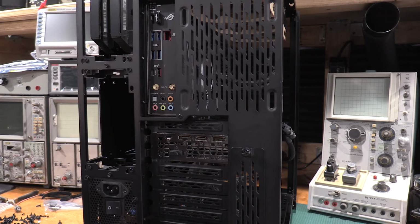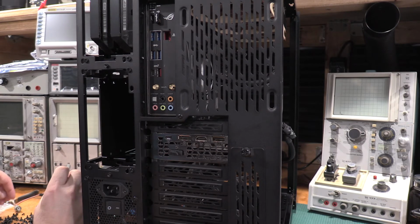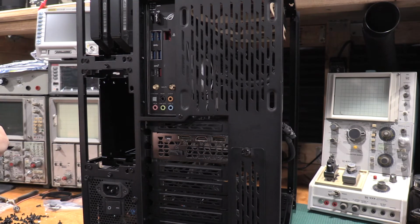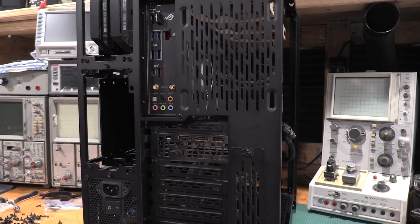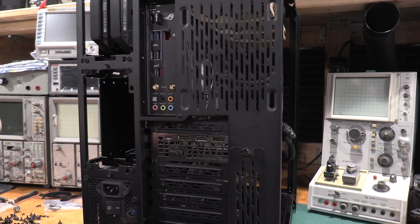I've migrated most of my primary home machines, if they're not purpose-built. The multi-purpose machines, the ones my wife and I use on a regular basis, all have RAID drives in them. I've standardized on RAID 10 simply because when you work on computers long enough, hard drives just tend to materialize around you, and I had plenty of hard drives to populate them with. It gives us the redundancy that I'm looking for, but it also gives us a speed boost on the drives.